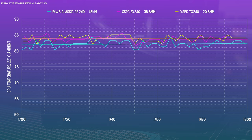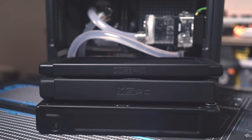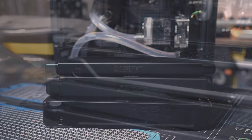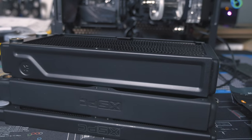While doing this comparison, I also measured the amount of water that each rad holds when full. By weighing each rad empty and full, the capacity can be inferred: the TX240 holds 108 milliliters, the EX240 164 milliliters, and the PE240 232 milliliters. From the data, clearly the thicker rad gives better cooling performance. But with this controlled experiment, the gap from top to bottom is smaller than some might imagine. For being more than twice as heavy when filled as the TX240, the PE240 delivers about one and a half degrees better coolant temps, translating to about two degrees better CPU temps for the 10700K.